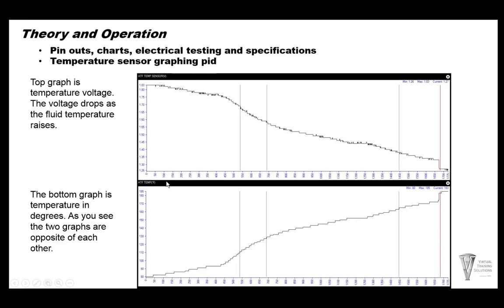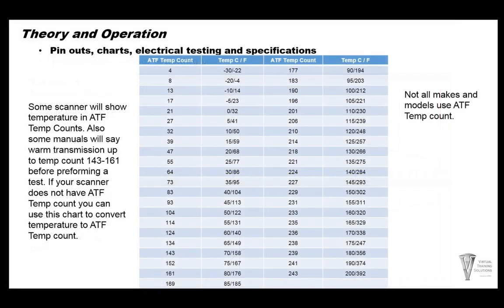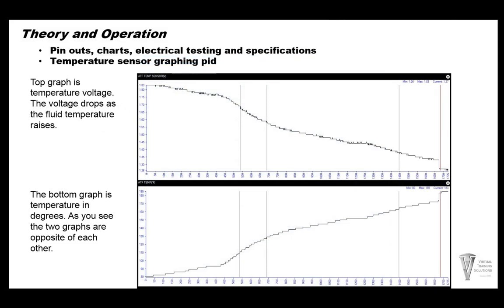The temperature sensor graphed out: as transmission temperature increases, voltage goes down — starting around 80 degrees Fahrenheit and ending up around 185 degrees. One important note: a lot of scan tools have temperature sensor reading problems on this unit — they don't read correctly. If you get an overheat temperature reading like 260 degrees, make sure you use a temperature probe to check the actual trans temp. There are known issues with the PIDs on Snap-on scan tools for temperatures not reading correctly.